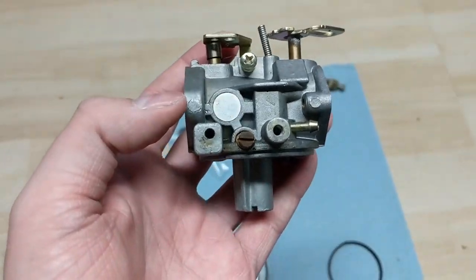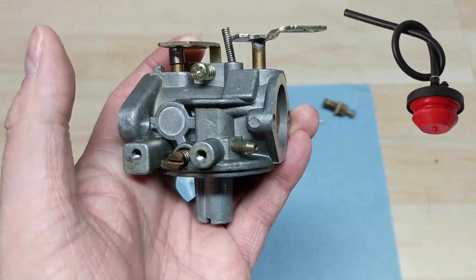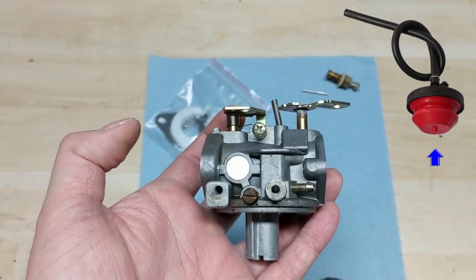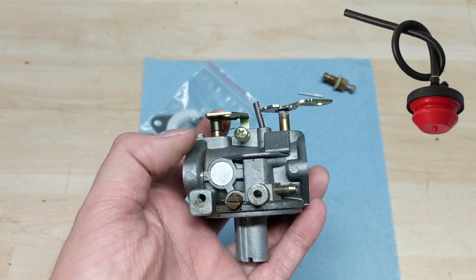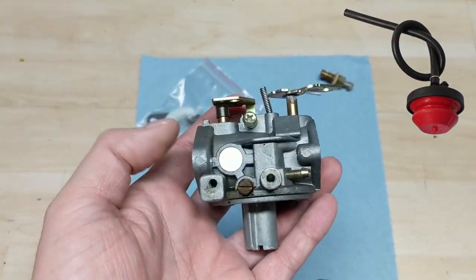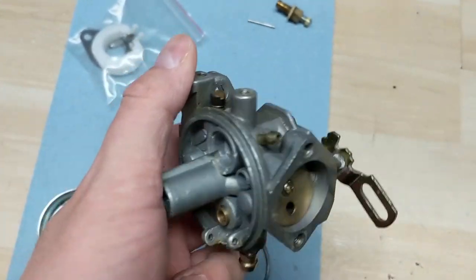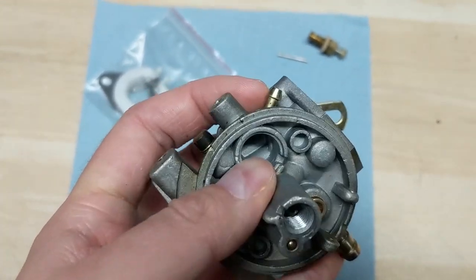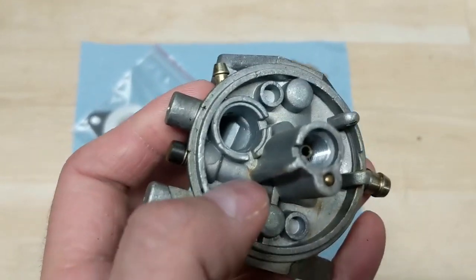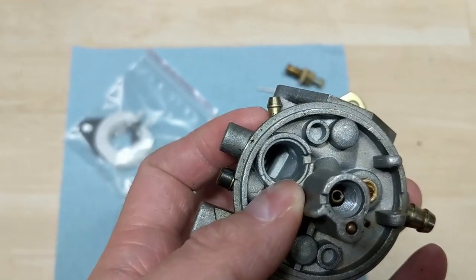So it's a good time to explain how these carburetors prime. Basically, you're going to have a tube that comes to that little inlet right there, and you're going to have a one-way pump — it's just an air pump. So you press down on your primer bulb and it pushes air into the carburetor. And when you let off, there's normally a hole in that primer bulb that's going to let the primer bulb expand again. So that primer tube comes into that inlet, and that inlet goes right to this hole. Normally there is a Welch plug, and you can see there are two grooves cut in to allow the air from the primer bulb to go through here.